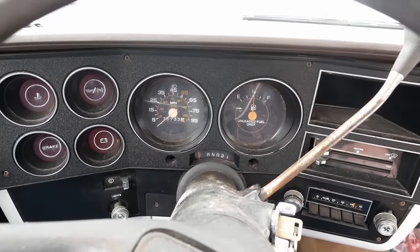Then it had the problem where it would fall on its face on tip-in, thought we had a vacuum leak. We tried rebushing the throttle shaft. We checked the base gasket. I replaced everything that could possibly leak a vacuum. What else? I finally knocked out the steel plugs on the bottom and adjusted the low speed mixture. That helped a bit, but it still just isn't consistent and it just didn't make any sense. And I finally found the problem.